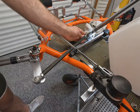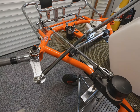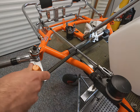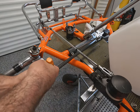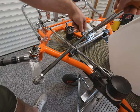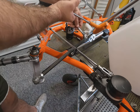It's important once this is all bolted in that the rose joint itself is nice and free and can wobble side to side, so it's not binding up on either the stub axle or the steering column where it bolts through. The right hand side is exactly the same so we're not going to film that, but once you've got them both on you're ready to do the wheel alignment on the kart.